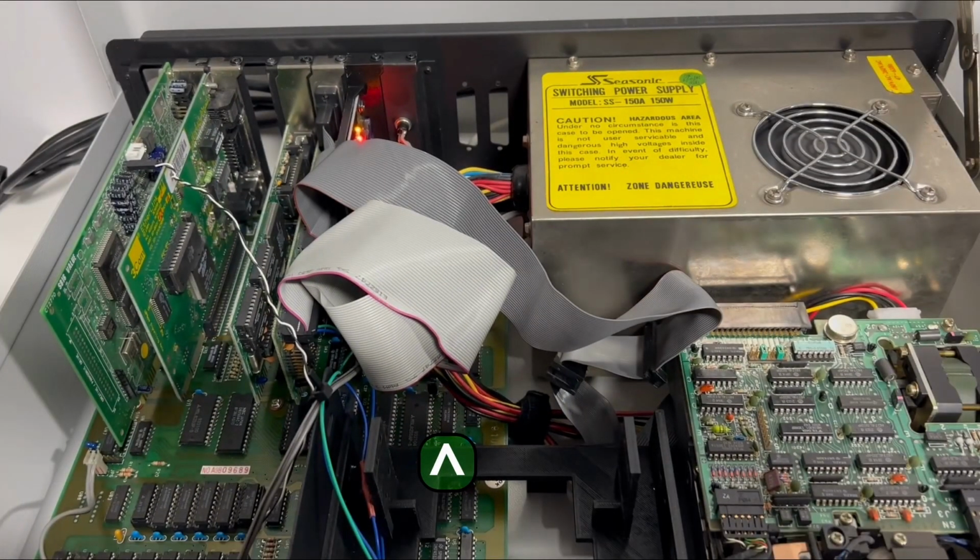As the XT cannot handle larger hard disks, I've got an XT IDE ROM loaded on a 3Com Ethernet card. The EtherLink III can run in 8-bit mode, and there are even configuration applications that have been patched to work on the XT. You should be able to use any network adapter with a boot ROM function with XT IDE. I just like the EtherLink line of cards and find them to work flawlessly.